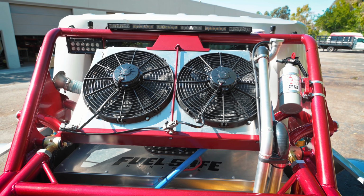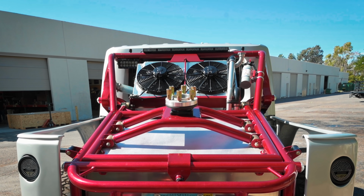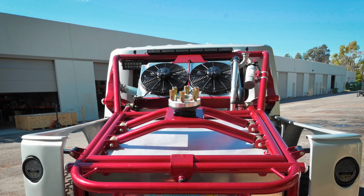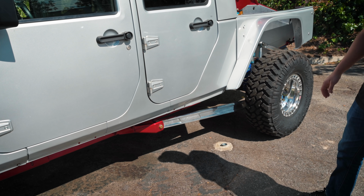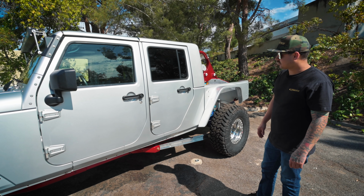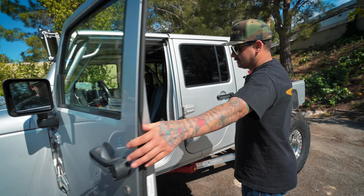We went for the radiator in the back and did the hard lines, 1.5-inch aluminum there. Remounted all the lights and antennas up top, just to kind of clean all that up. Changed all the hardware out, had coarse thread bolts in it, and so we just changed everything out for grade 8 fine thread.